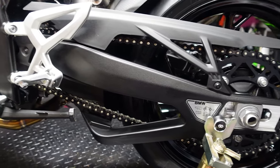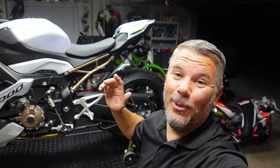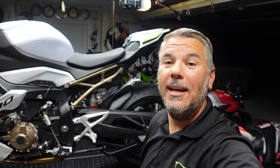There we have it — the Super Light chain and sprocket kit by Drive Systems. Huge shout out to them. Thank you for making it so simple to get this thing put on with no additional cutting. I'll link everything down below to this chain and sprocket kit. I went down one tooth in the front. I went down one tooth on the Street Fighter and regretted it, but it's a much different animal — and that was already down one tooth from stock. The gearing on the S1000 Single R is actually the same as the Double R. So going down one more might be good. We're heading to Buttonwillow at the end of the week and Buttonwillow is not a really fast track, so going down one gear is going to be really, really good. The following Friday we're at Thunder Hill, where going down one gear might cripple this bike because of the long straightaway.